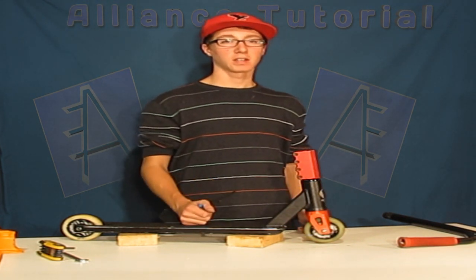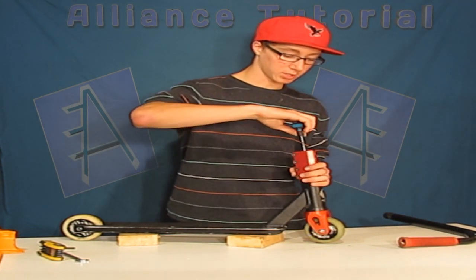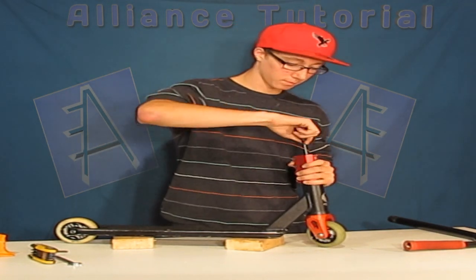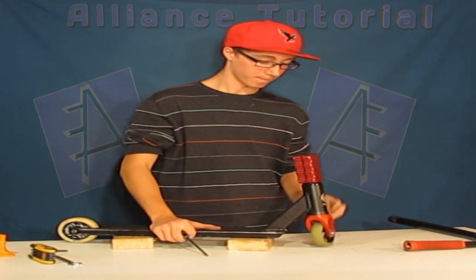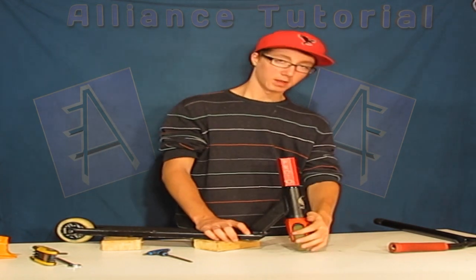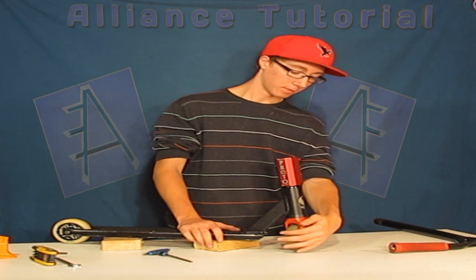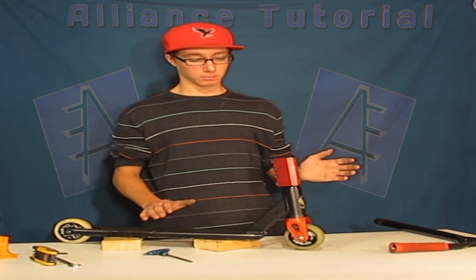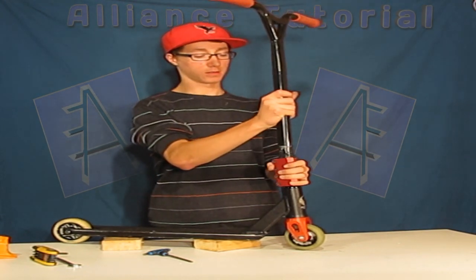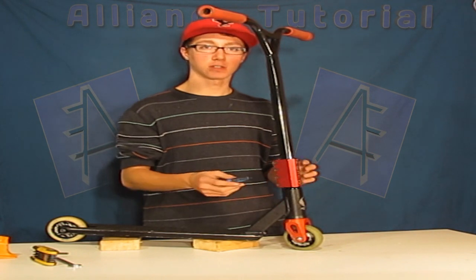Now ICS — it's really hard to get tight, but it is possible to get dialed. So you want to tighten up your compression whether it be HIC or SCS. I like my compression so I can spin it around one rotation. Other people like to have it one and a half or a full one — I like three-fourths of a full rotation, but that's just me. Then you want to put your bars on, line them up, and tighten your clamp.